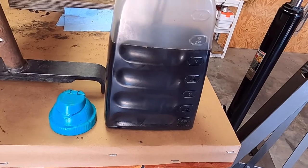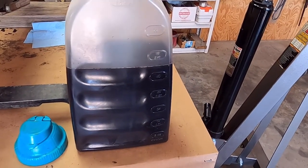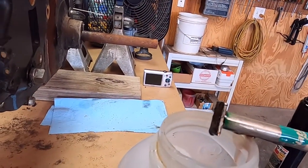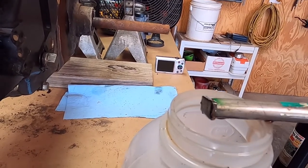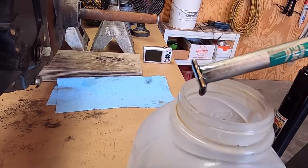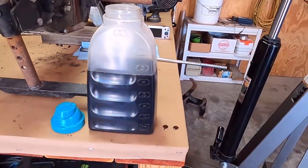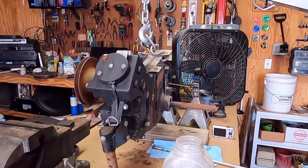I'm just curious to see. I think we're good — I don't see any serious metal chunks. I'm going to wipe this down and I think we're good on oil. I'm just going to put three pints of 30-weight back in it once I get it all cleaned up and painted.